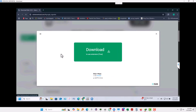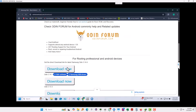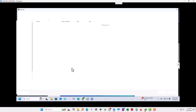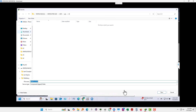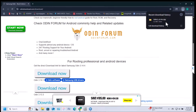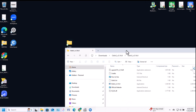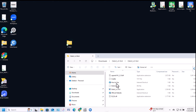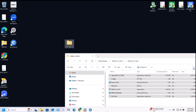The first thing you need to do is download Odin, which is the software we're going to use to flash the firmware on the Samsung device. Save it somewhere and extract the files into the A116U folder on your desktop — drag and drop the files into the folder and the first software is good to go.